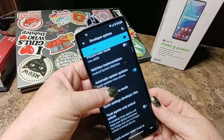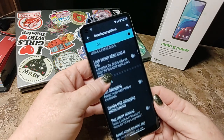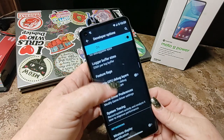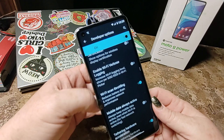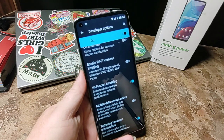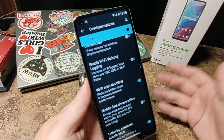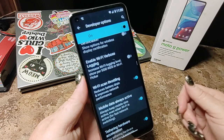Some pretty standard stuff here. These two are new — let's see. Pretty standard stuff here. Feature Flags — this is something new and it's still experimental, so it's not going to tell us anything about it. Alright, this is something I do: I keep Wi-Fi Scan Throttling on, because a lot of phones will be constantly looking for Wi-Fi and that will drain your battery and can affect your performance. And Mobile Data Always Active — I always turn that on, just because I have unlimited high-speed data and I don't want to have to worry about turning it off and turning it back on.